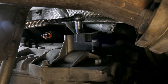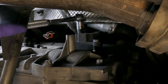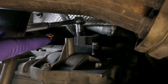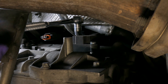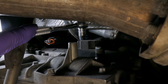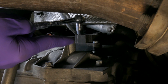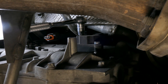Now I'm going to go ahead and start doing the rear coil pack and spark plugs. I have my T40 on a quarter inch ratchet, and I went ahead and broke them loose — it did not give a fight at all. There's plenty of space to get that ratchet in, and taking a look at just the spacing here, it looks as though this coil pack is going to be able to come out relatively easy.